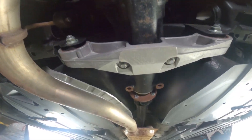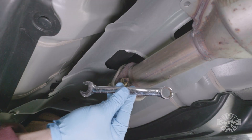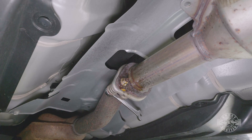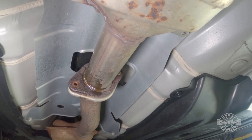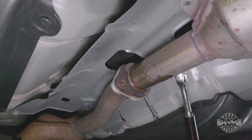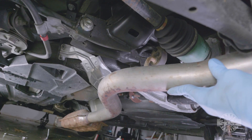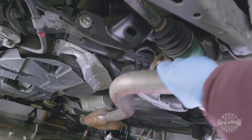Now the next step is removing the rear exhaust pipe and for that we have to go all the way to the middle of the car right here. We're gonna need a 14 millimeter wrench for the head of the bolt and the nut is 12 millimeters. To make this easier spray the bolt with some penetrating catalyst and let it soak for at least 10 minutes or so. In my case the bolt was so rusted from the Buffalo winter and the road salt that comes with it that it broke in half almost right away. The same thing happened to the other bolt. Thankfully we will not be reusing them. Before taking these off make sure you put something underneath the rear pipe in case the bolts snap like mine did, so that the rear pipe doesn't slam down. Now the rear pipe will dangle in place because of this exhaust hanger right here. Exactly like we did the mufflers we're gonna wiggle it right out just like this.